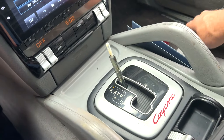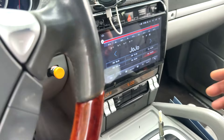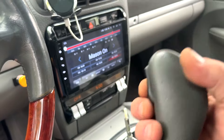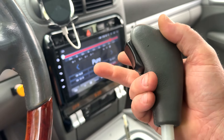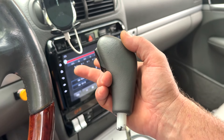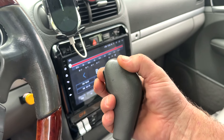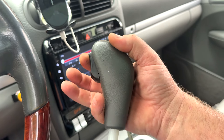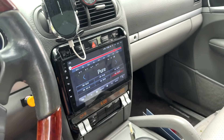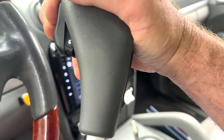Make sure that little collar stays back on. For now I'm going to have to find myself a replacement shift knob. When you put the new shift knob on, do not push the button with the shift knob off — I cannot stress that enough. Do not push the button with the shift knob off, because it will lock itself in and you will not be able to get it on, and if you try to force it on it will break internally. There's a little reset mechanism.